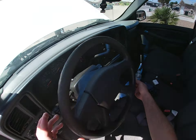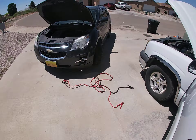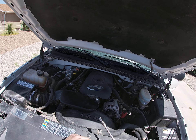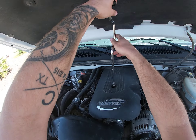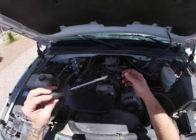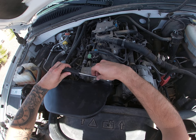Make sure you turn your car off. The truck's got a bad starter, so if I go to start it up again and it doesn't, I'll have to cut that part out. You're going to need your 8mm socket, speed handle or ratchet. Take it off right here, take your plastic off — just gives you better access. Also, you're going to have to get your flathead screwdriver to take off this hose clamp so you can get to your throttle body.